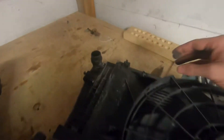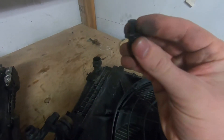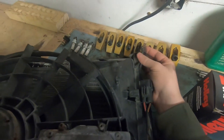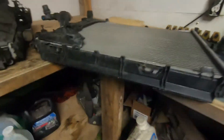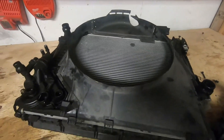So the first thing you have to do is pull off the shroud or the fan, depending on which one you're working on. It's really easy. There's one clip up here — I already have it out. You just pry off the middle piece, pry this off, and then there's also one bolt over here you have to pull out as well. Once you have those out, this whole thing will actually just slide up and out and off of the rad. It's the same thing with the automatic — it's just a shroud instead of an entire fan.